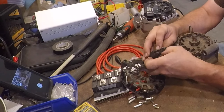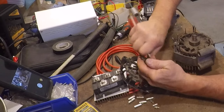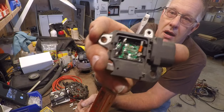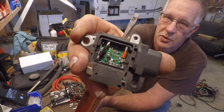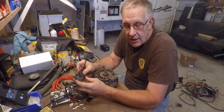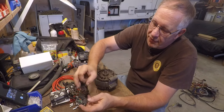The regulator here has also been bypassed. Just to show you what bypassing this alternator looks like, I'll pop the cover off. You can see those two simple wires that have been bridged across, and the rest of the regulator has been removed from the circuit. That's what's involved in setting it up for an external regulator.